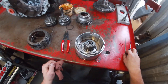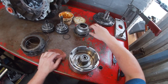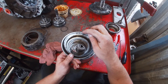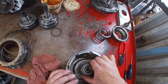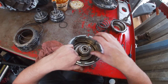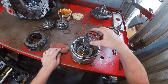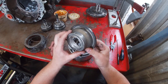Our next step is going to be a bit of a fight — it's usually always a fight putting the apply piston back in. We're going to put our lower piston assembly down in. I like to line this notch up with one of the other notches. It doesn't matter which one, but it's usually an indication for telling whether it's down all the way, because you can actually see that it goes flush with the inside basket. We're then going to place our spring and use our apply piston. We will need to grab an installer for this.